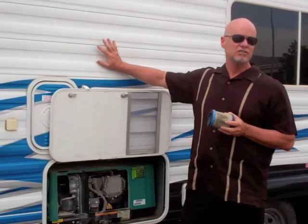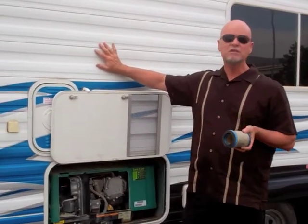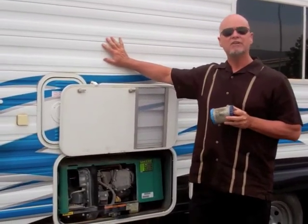So that's a little bit about cleaning your vehicle after the burn. You want to do it as soon as you can, because that alkali dust just eats into pretty much everything. It also will eat into your electronics. If you have a car, you probably want to blow off the engine, or even get your engine professionally steam cleaned, because that dust will get into your electronic components and it can do a lot of damage to your vehicle.